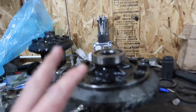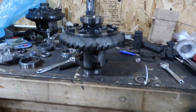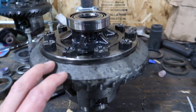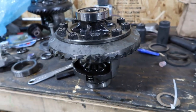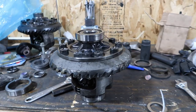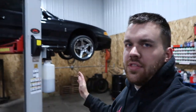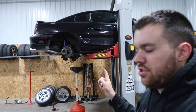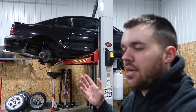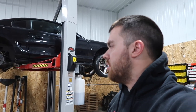Ring gear is installed and torqued, everything's good. My bench is a complete mess — one of the worst I've put on the channel — but look at the differential setup we've got going. Tomorrow I'll make sure the pattern is good, adjust pinion depth if needed, and put her back together for a final test drive. Of all the things we've done to this car, changing the gear ratio from a 3.08 to a 3.55 is hands down going to be the best idea. I'm going home to take a shower — I smell like gear oil, which any gearhead knows is probably the worst thing to smell like.